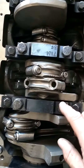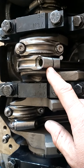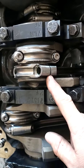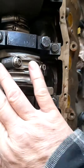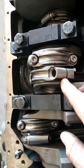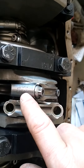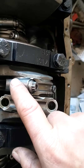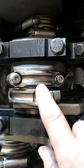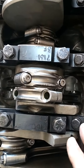When you put these together, you get your aftermarket rods. They don't come with any numbers or stamping, so I always stamp right there along the side. It doesn't matter which side you do it on. Some people prefer to do it on the lock side; I prefer to do it on the side facing toward the outside of the engine because it's just easier to deal with. Not only do you want to stamp here — so this one's 2, this one is 6 — and you see this one's got two rows stamped right next to each other on the same side of the rod and the journal cap. On the journal cap, I put six hash marks toward the front of the engine, so there's no way to screw it up.